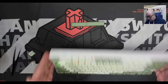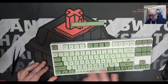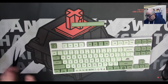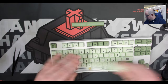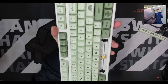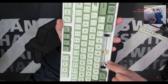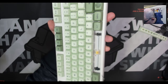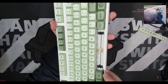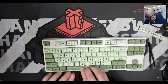Turning the wireless off and plugging it in — that's a tilt, not a cup. Let's take a look at the stabilizers. We've got plate-mounted stabilizers. The plate foam appears to have shifted slightly — hopefully it's not going into the stabilizer. The stabilizers are your basic plate mount, though they are quite well attached and they do appear to be lubricated, which is a very good sign.